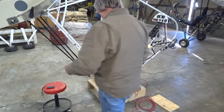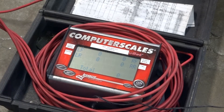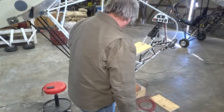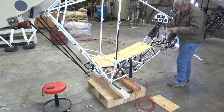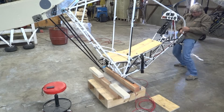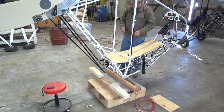We're going to do a few things here. We've got a set of scales and we're going to use them underneath the airplane to validate how much total weight we've got. I'm going to zero those out. We're using two scales, which puts us more in range with the total capacity because each one of the load cells is only 1,500 pounds.